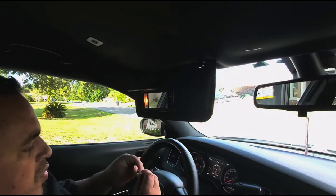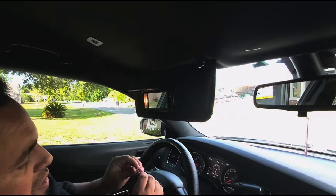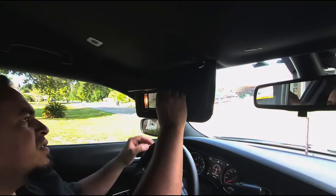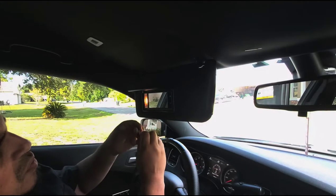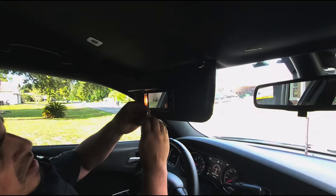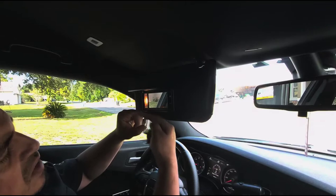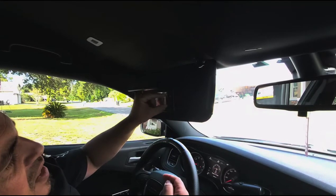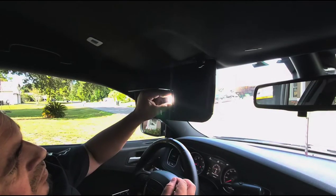These are LED boards. What the manufacturer did is literally just soldered the boards to the same cap that we have. Sometimes it will come on, but if you put it the other way it doesn't come on — you have to be patient. This is LED, so current only goes one way. Positive has to be on one side, negative on the other. If I put it in and it doesn't come on, I flip it — and there you go.